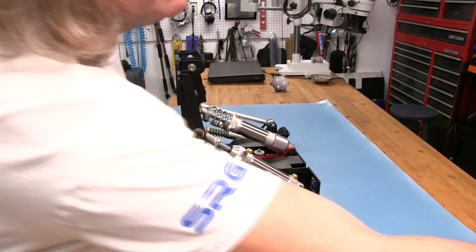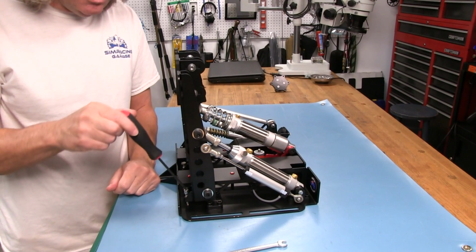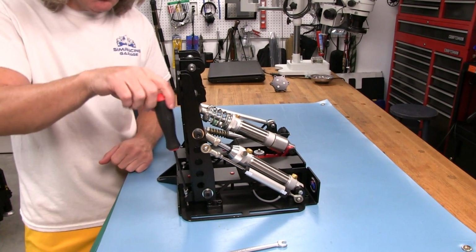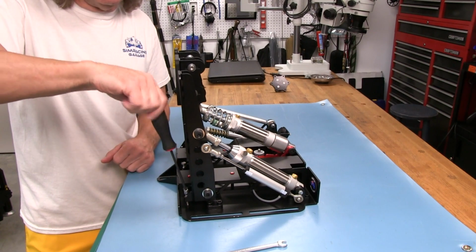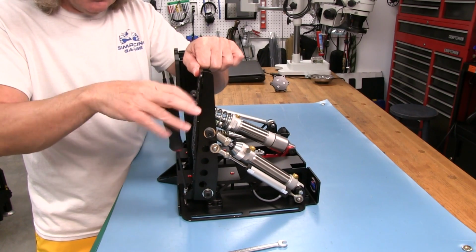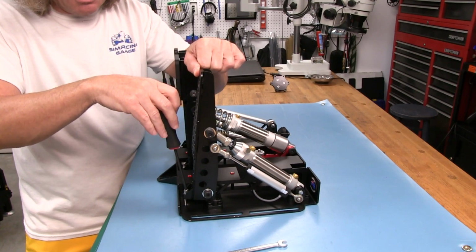And that way we can get a look at the angle we have on the brake pedal. And I'll get my 4mm wrench out. And this is a ball end, which again is very nice because getting straight up against it is kind of hitting the pedal. But I can actually get off angle here and make the adjustments. So as we screw this down, the pedal actually moves towards the rear. See how it's moving? And it helps if you obviously take a little pressure off of it when you screw it down. So actually, I'm going to go ahead and screw it all the way down to see what the range is. And there it is, maxed out.